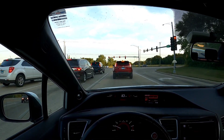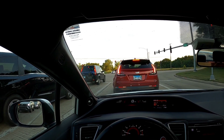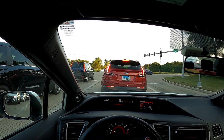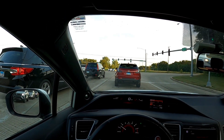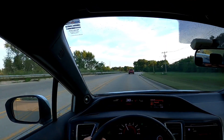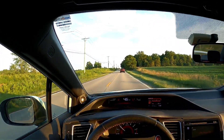I'm in second gear right now, and as I'm coming to a stop, going to neutral — clutch is out, foot's still on the brake. If I know I'm going to be stopped for more than two minutes, I'll put the handbrake on and then take my foot off the brake so I don't have any feet on the pedals. The reason why you don't want to rest your foot on the clutch — whether in gear or not — is because that could prematurely wear out your throwout bearings. You replace your throwout bearings whenever you replace your clutch, but you don't want a clutch problem stranding you in the middle of nowhere. So it's always crucial that you select neutral when stopped for any given length of time.